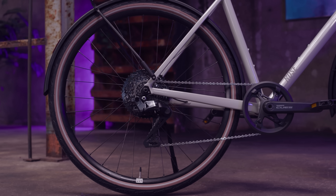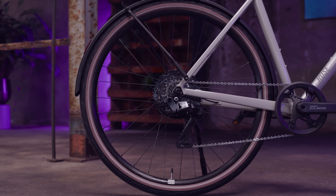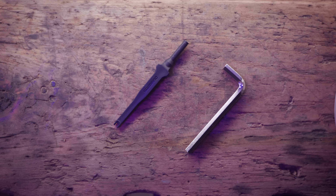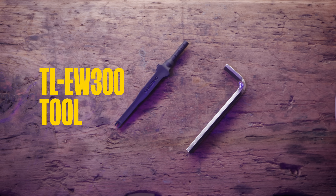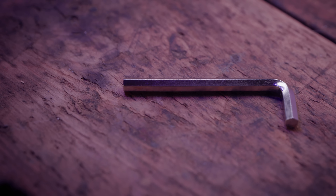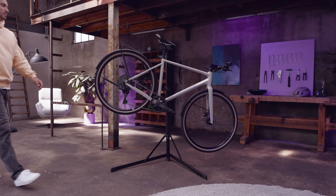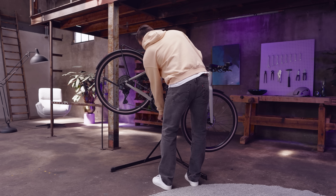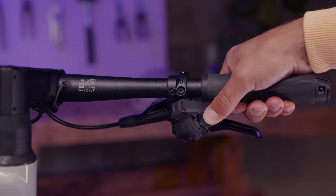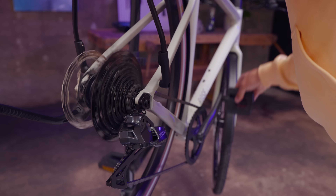Sometimes you might need to remove or replace a wheel. A flat tire or any kind of servicing may require removal of the back wheel. You will need the following tools: for wheels that don't have a quick release lever, a hex key. If you don't have these tools, please visit your local Shimano dealer for assistance. Make sure your bike is in the top gear — that's the heaviest. With Q-Auto, there are two ways to do this: if you have a shifter switch, you can use it to shift up to the top gear, or you can simply lift the wheel, use your hand to pedal, and watch the automatic shifting system shift to the top gear.